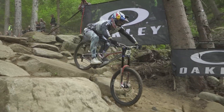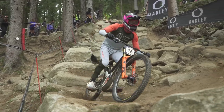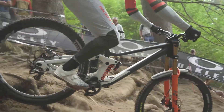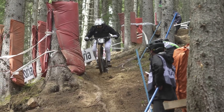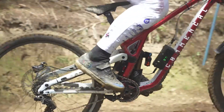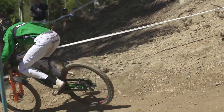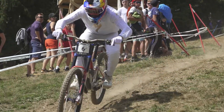There is no universal rule for tuning these settings because it depends on your weight, the sag you set at the beginning, your riding style, and your feeling. This is something you have to change one or two clicks at a time on the same trail and experiment, checking your impressions. It also depends on what kind of ground you are going to ride. A setup for DH lines is definitely different from a flow line or jump lines, because if I set up my suspensions for a DH line I will lose a little bit on flow lines — in the berms I won't have the support the suspension should have, and I will lose some power exiting the berms.